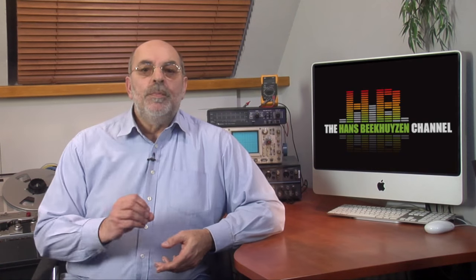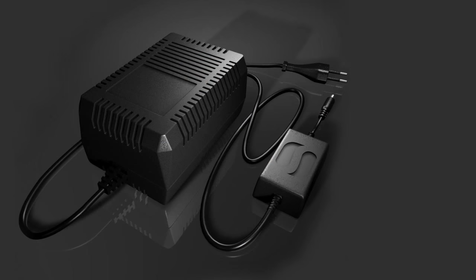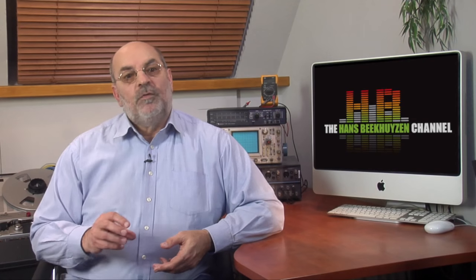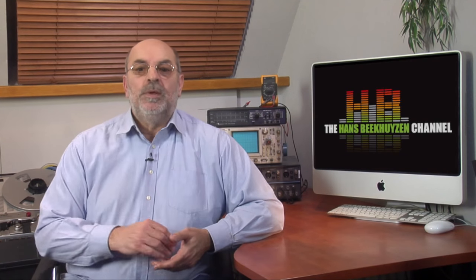No, when I replaced the switching power supply with the S-Booster Best of Two Worlds power supply, the sound immediately improved. Don't forget that the Nuforce DA converter is fed from the same power source as the Raspberry Pi and that the power has to travel through the Raspberry Pi. Adding the Jitterbug did give some improvement now. Here not only in the mids, but also in the highs.